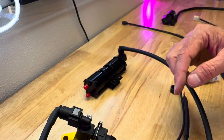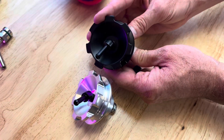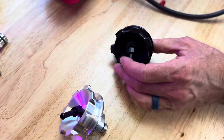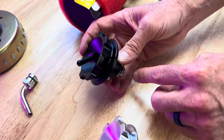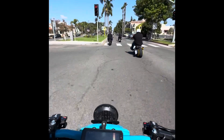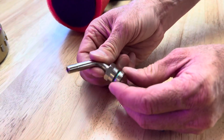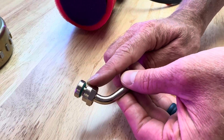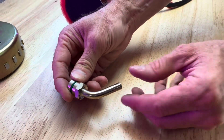You have that return line going back into — we have two options. You can choose a gas cap. We've got black and we've got raw. You can just plug your return hose from your fuel pump right into your fuel cap. This bolt is hollow — that's how it works. It'll send the fuel back into the gas tank. If you don't like that look and you don't want that, we do have this option — this is included. This will require you to drill a hole in your gas tank and install this tire valve stem. We've added a Viton O-ring so the gas doesn't affect it, and we take the valve core out. You drill a hole in the tank, install this, and you've got a return line to your gas tank.